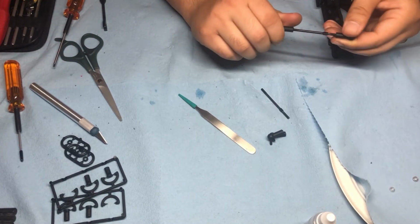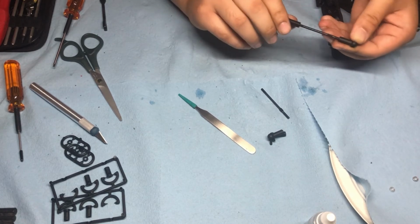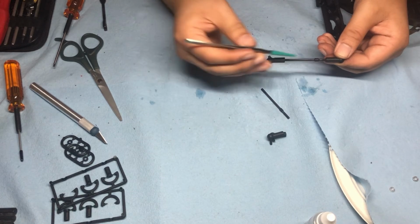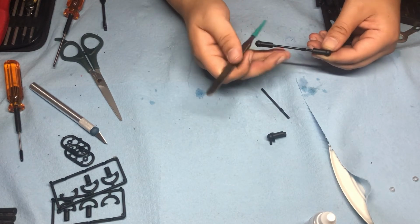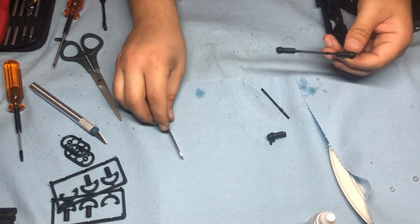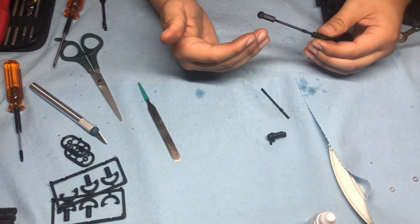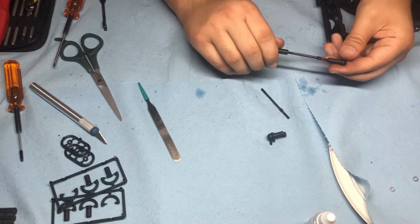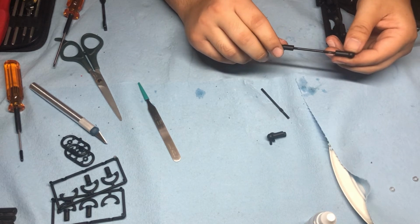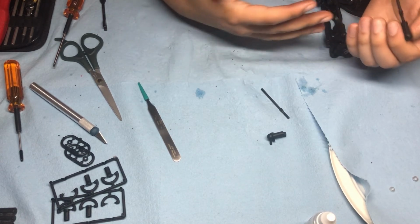Alright, so I'm installing the turnbuckles a little differently than what the manual is suggesting. The manual is suggesting that the adjustment portion is always facing the outside of the car. That means the right hand thread is always on the outside of the car. However, I feel like the industry standard is you put the left hand thread on the left hand side of the car. So all of my cars, whether it's Traxxas, Team Associated, Techno, even Red Cat, they're all that way. So that's what I know, that's what I'm familiar with.